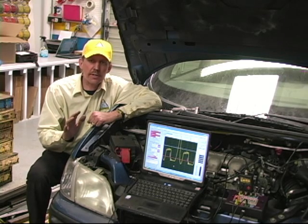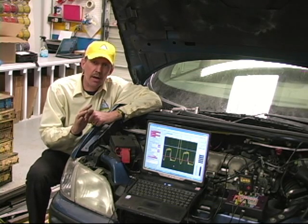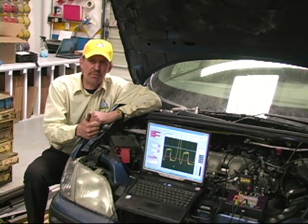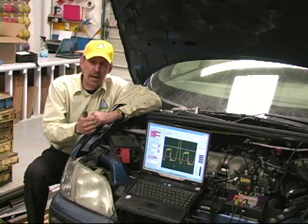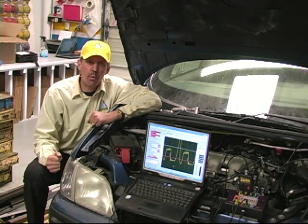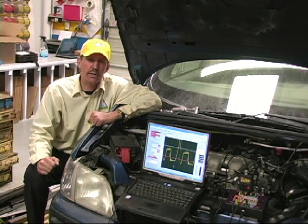This whole process to find that this exhaust valve is bad on this Chevy Venture van is under 30 minutes. It targeted the misfire to the correct cylinder and then targeted the compression and gave you the analysis of what was incorrect with the motor, what was wrong. What was wrong is the exhaust valve.